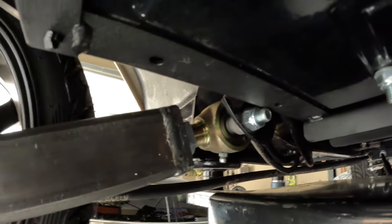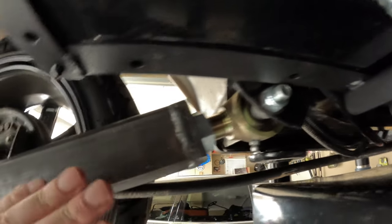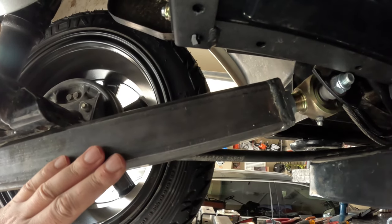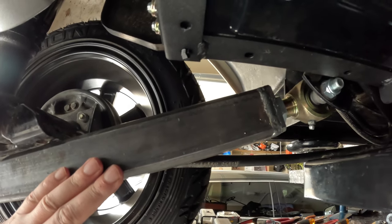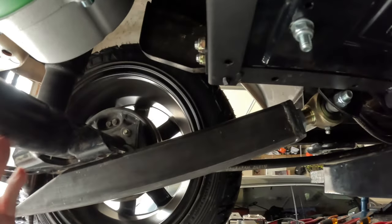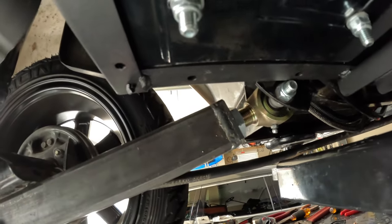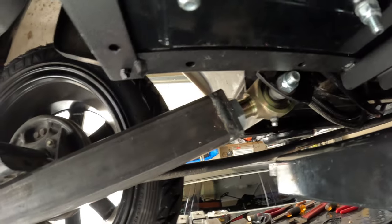Starting from the front - the Johnny joints are mounted up with M12 bolts, you can see the jam nut. I probably should have cut this bar a little bit shorter. I was measuring it against the leaf spring with the lowering block, but I didn't account very well for the curvature of the leaf spring since it wasn't flat. I did this intentionally though, so I could hopefully center the tires in the wheel well better over time as I drive and figure out how much more to shorten it.